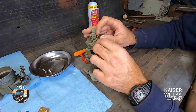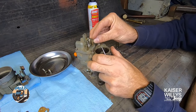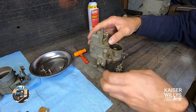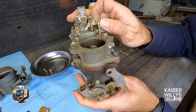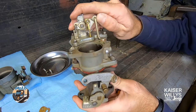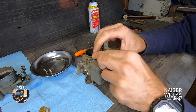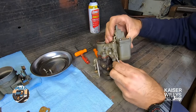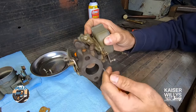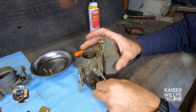Continue on removing everything - a little clip and little springs, all these goodies. Keep all your parts together and keep chugging away. This longer rear rod connects the main throttle shaft to the metering rod and the accelerator pump, so we want to make sure to remove that before we can split these sides any further. Just pop these little pins out - they like to go flying, but thankfully the new kit includes them. This clip on the bottom just spins forward and slides out, then you rotate it up past the carb body and slide it out.